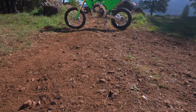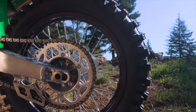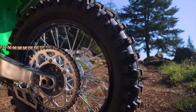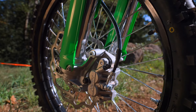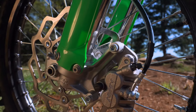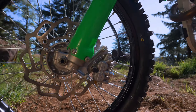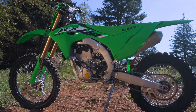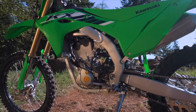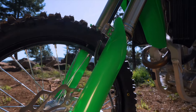The X model has an 18-inch rear wheel with Dunlop AT81 tires. It's got different suspension settings — I believe a two spring-rate lower front and rear for the fork to make it softer all around — and then you get a kickstand on the side. All those changes are $100 more than the standard bike, so it's like, are you going to build your own bike or spend $100 extra and just have these changes already?